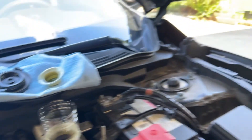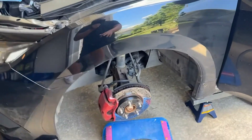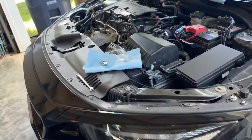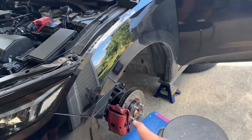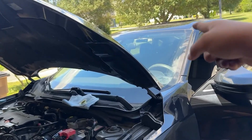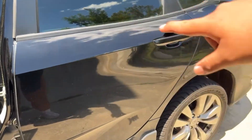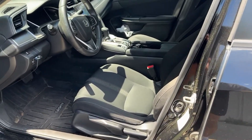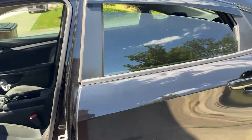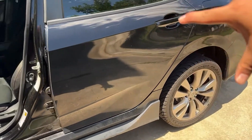Now just go ahead and close the lid and start pumping the brake fluid. I forgot to mention that when you're doing these brakes, especially for a Honda Civic 10th gen, the order to bleed the brakes is: driver side front, passenger side front, then you move on to the passenger rear — make sure your e-brake is off — and then rear driver side. When you've bled all of those, hop into the car, turn it on, and engage the e-brake five times, meaning turning it on and off. That's one. When you've done that, bleed the two rears again and you'll be all set.